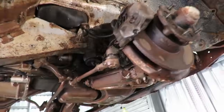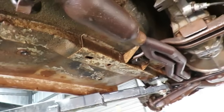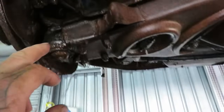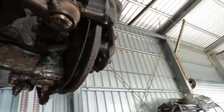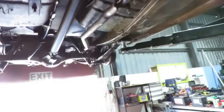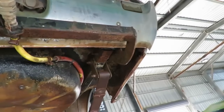It's wet everywhere but it's far from clean, but you've got to get some of the gunk off to be able to work on it and see what you're dealing with. The floors are actually quite good still - I haven't found any terrible bits. The ball joints are not too bad, and even the tie rods and stuff are actually better than what I thought. I'll grease them up - there's not a lot of movement in them. I'll put shocks in it front and rear. It takes a while just to get them to a point where you can actually work on them, clean enough to actually do something with them.